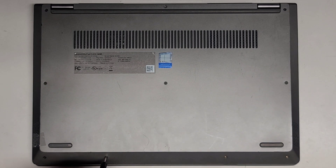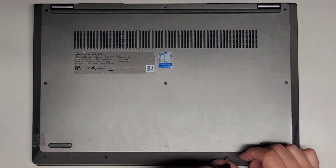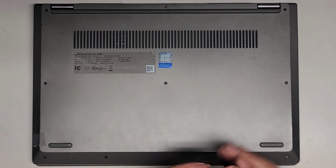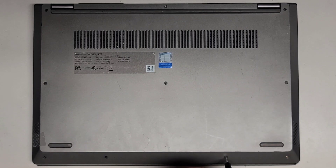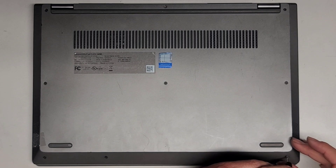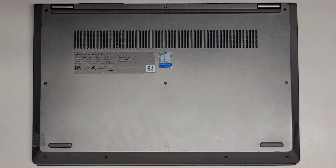Looks like I was able to fix it better than I was hoping, because I was worried thinking maybe it was the power button that was broken. If that was the case, they could turn it on using a pin with the one key recovery button. But best case — it actually powered on after just doing a battery power drain. Anyway, that's it. Thanks for watching and I'll see you all in the next one.